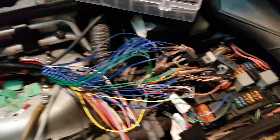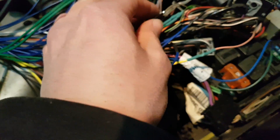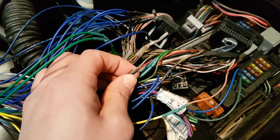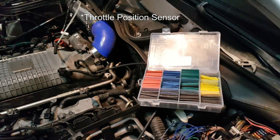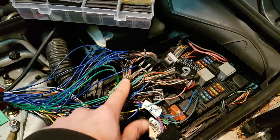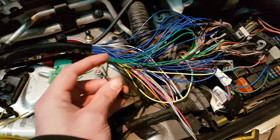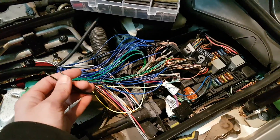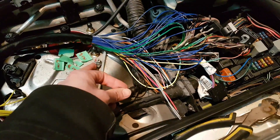Now I'm done with most of my connections but I still have the power connections to power the FIC. I've already connected my signal ground — signal ground is different from regular power ground. Signal ground, or sensor ground, is a clean ground wire that grounds all the sensors: the manifold pressure sensor, throttle body, and basically any five-volt sensor in the car. It doesn't have any noise in it. The power ground is what actually powers the ECU — since it has to control all the injectors which draw a lot of power, it needs a proper ground. That's why there are two ground wires. Both these wires do the same thing — you just need to connect them together, and I'm grounding them right here at this chassis ground with a nut.